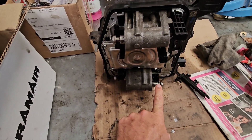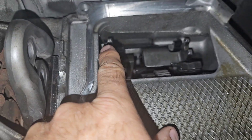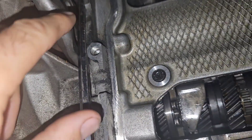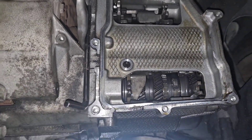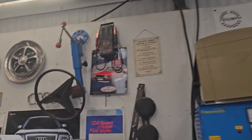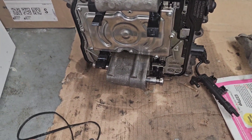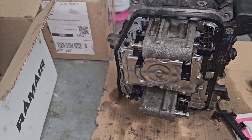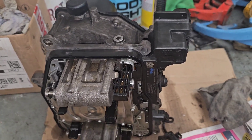I pulled all of these in and out to get all the air out. The only hard job now is lining up these four forks — one, two, three, four — with the actual forks here as well. Those bits have got to slide in square. I've put this Allen key here just to push this back a little bit because the tool still hasn't arrived — these keep the forks and clutch just pushing back. I'm waiting for an oil seal that's going to be delivered today. Here's the old one — it was not very good. I'll replace it, it was only 13 quid delivered, so you might as well. When it's all here I'll throw it in and hopefully the gearbox will go into gear and move.